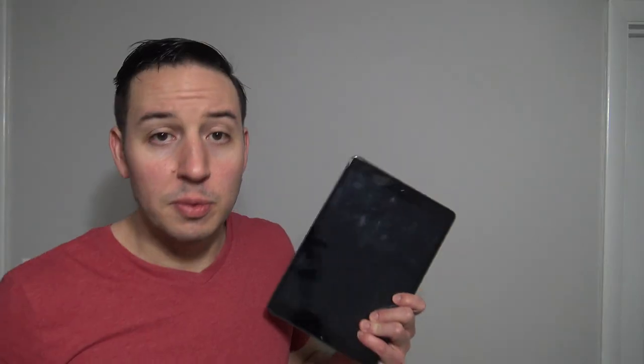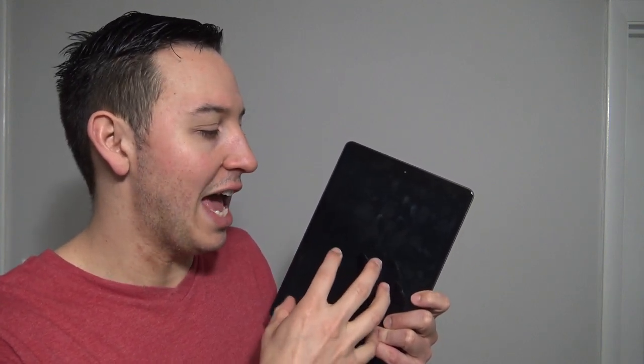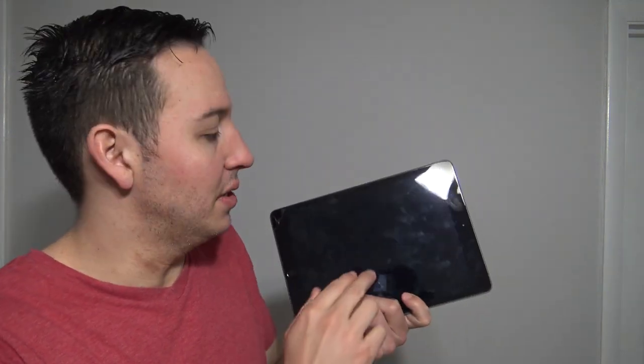First, let's talk about what not to do. You never want to use any kind of household cleaners, alcohol wipes, or any kind of chemicals on the actual iPad screen. The reason why is you could damage what's called the oleophobic coating — that's what gives it that slick-to-the-touch feel. The coating makes your iPad fingerprint resistant, meaning when you touch it you'll leave a fingerprint, but then you can wipe it away and it'll look brand new. Without the coating, grease would just adhere to the screen and wiping it would only leave streaks.